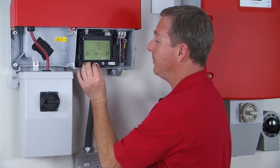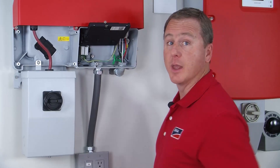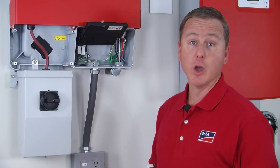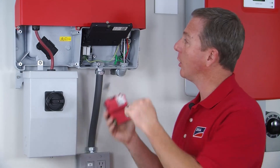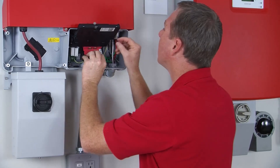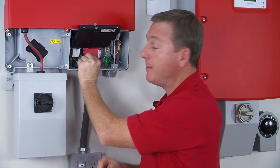The second thing you're going to do is unscrew the LCD display retention screw and lift that up and lock it in place. Now we can see where the WebConnect module is going to go. Feed the ribbon cable around the top of the LCD display, then insert the hex screw into the retaining area.